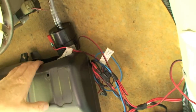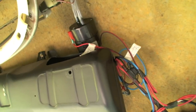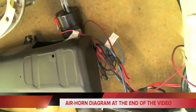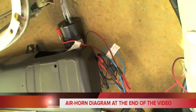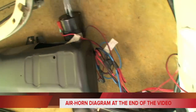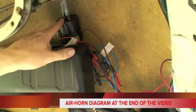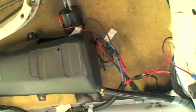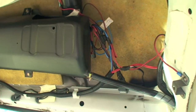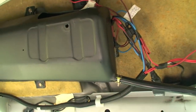The compressor is mounted up there. Because I haven't got my 12-volt house batteries hooked up to the earth of the body of the car, I've just run the earth straight back to the battery — if I run the earth to the body of the car it's a 24-volt earth and it just wouldn't work. So there it is — that's all pretty straightforward, not much to say about that really.